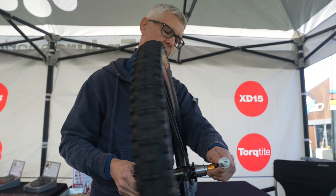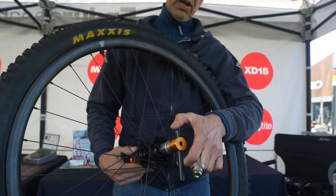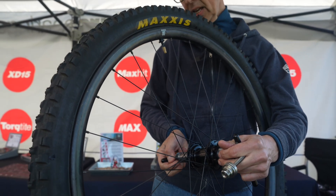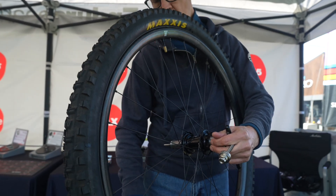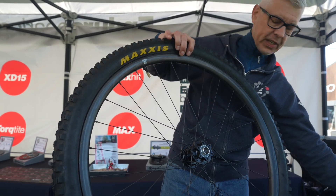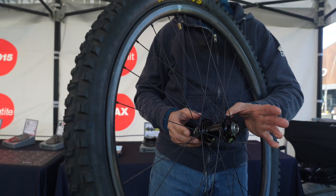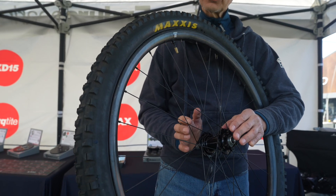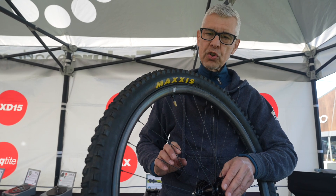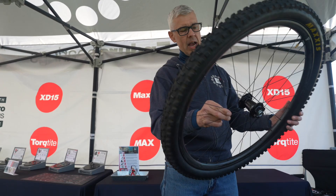Then we just want to have a guide on the other side to keep us straight and flat — this is our long over-axle guide that will slide over the axle to give us enough room so that we can press that bearing back in place. You can see it's going in. You want to just get it slightly snug — you don't want to over-tighten these. Quite often we see that the tolerances are slightly off between the axle and the hub shell. You have to get that spacing perfectly, or else you might get a little bit of movement or a little bit of tightness. If it's a little bit rough, just give it a tiny adjustment by going through the process of removing the bearing but just barely starting it, and that will give you a nice smooth finish.